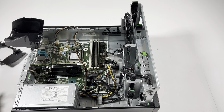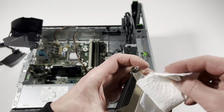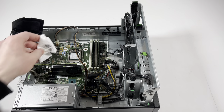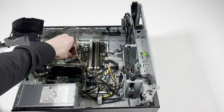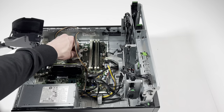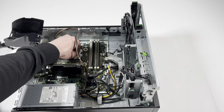What I need to do is take a paper towel and wipe down the thermal compound first, same with the CPU before you remove it. It's got an i5-6500, 6th gen, and I'll upgrade to 7th gen i7-7700 — it will support i5 and i7. It also supports Xeon CPUs, so it's a pretty cool machine. I'll put a link in the description so you can see the CPU support list — you can also install a 6th gen i7-6700.